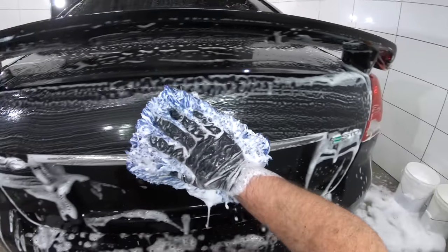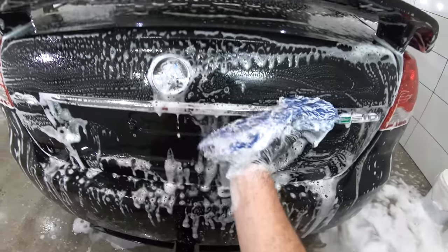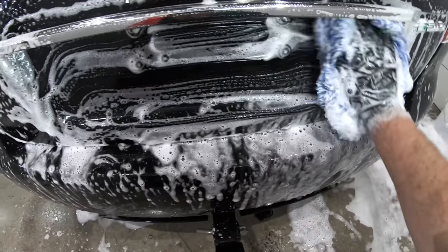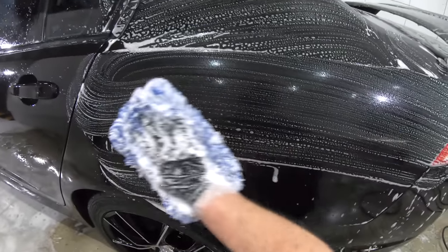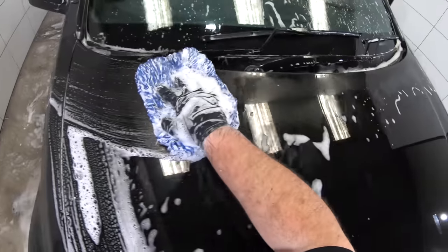It's also fair to say that a pressure washer will be far more effective in thoroughly cleaning the wash pad out, but it's also a lot more messy and you need to step away from the vehicle as to not blow the dirt back onto the car. And as car wash soaps aren't formulated for spray bottle use, you also need to spend a little time working out good dilution ratios, which may be different for different car soaps.